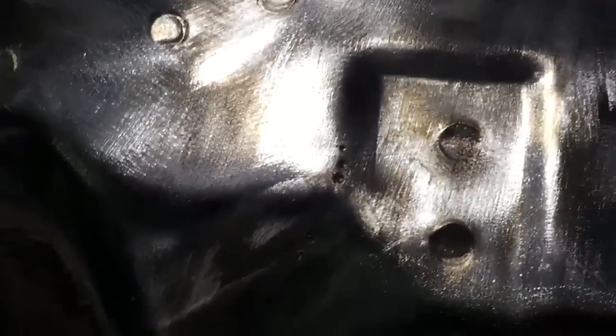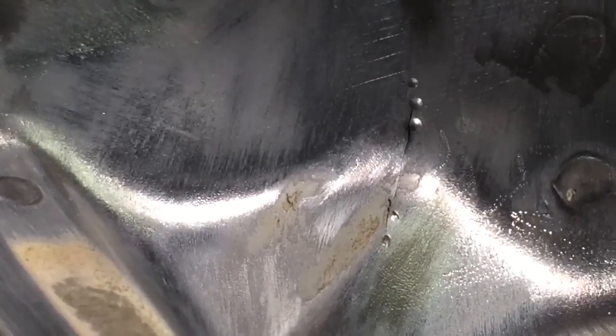And then interestingly, on this right rear, the one that's really hard to find faults on, I'm really pleased because we have found a crack there. I was even doubting myself whether there was something, and various amounts of gentle center punches around that area have proved that a crack is there and it's opened up quite nicely. So we've center punched the ends and found the ends of it.